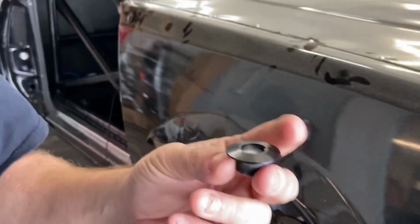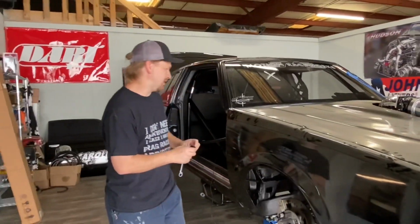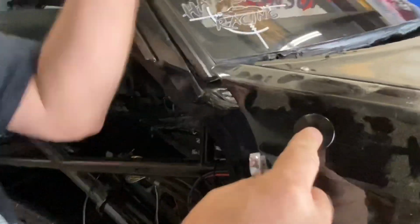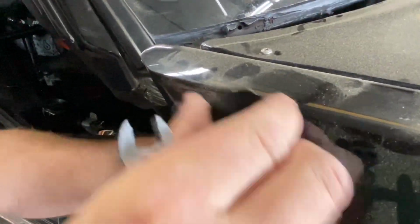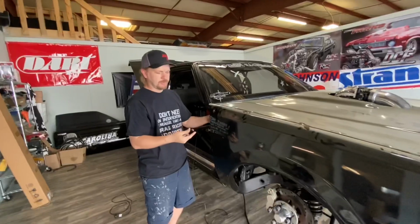For a hood, they're great, but for something where you gotta stretch it around or on the side, basically the problem they're having is with this fastener in here, it's hard to drop the front end straight down because it interferes with this button. So you're having to stretch the hood really far out to get it to latch on, but it just doesn't work.